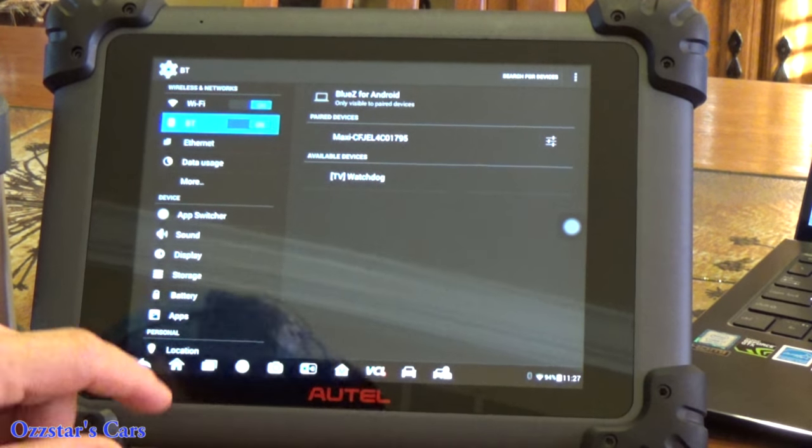You get all these adapters — I believe this one here is for old-school Mitsubishi. Here's your power charger. Up here is a unique USB with a proprietary connector shape on one end and a standard USB on the other — this connects the VCI to your laptop or scan tool for updates. If you're having problems with your VCI not connecting, try updating the firmware on it. It also comes with a cigarette lighter charger, some battery jumper connections, and old-school OBD1 adapters like the GM connector — though as mentioned, OBD1 is not supported by this tool.